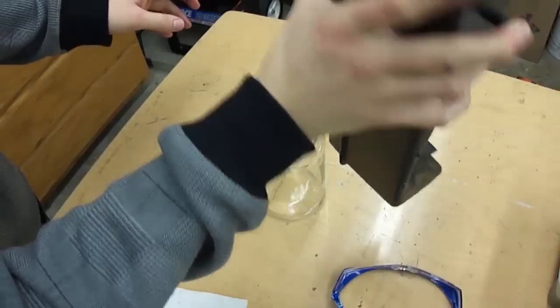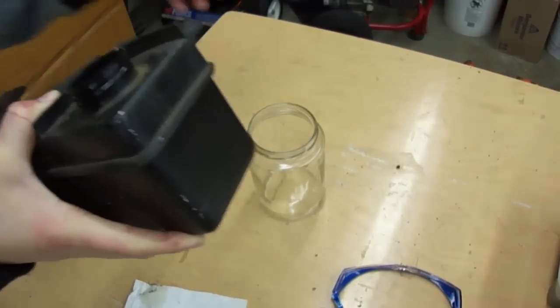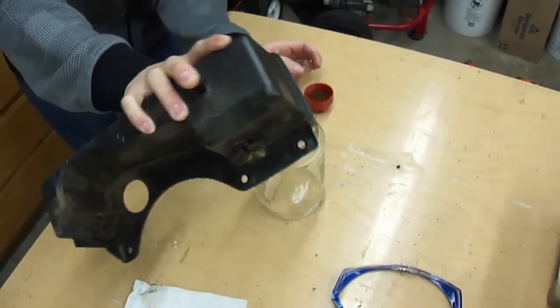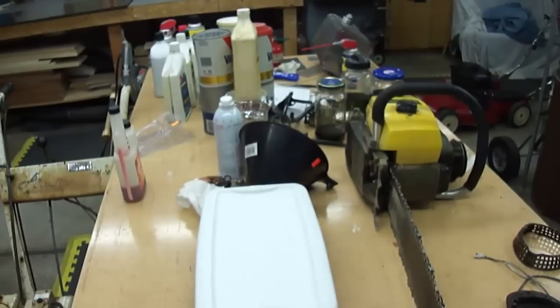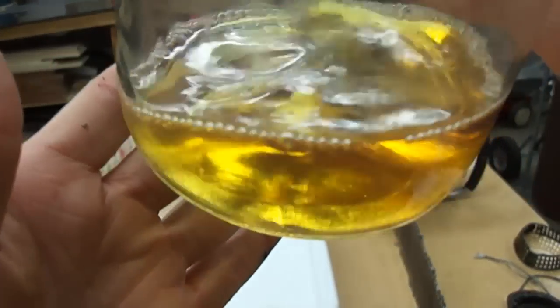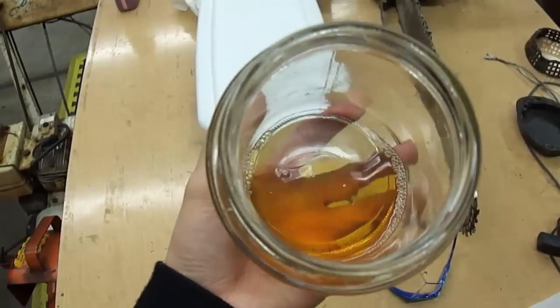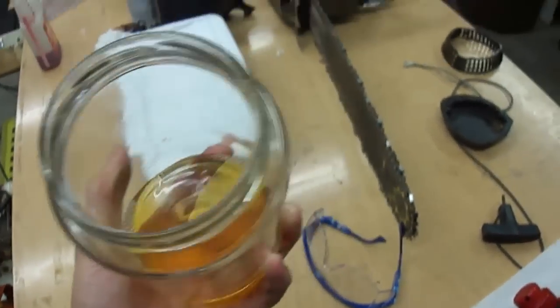I've just got my hand over the line, the exit. Two indications of having bad gas: dark yellow color like this, and at the bottom, lots of grass shavings and probably dirt. I'll put some fresh gas in the tank a couple times, rinse it out, keep on pouring it in so the tank is cleaned out.